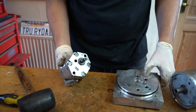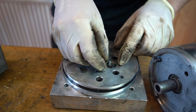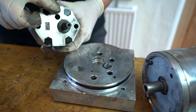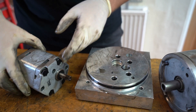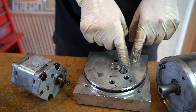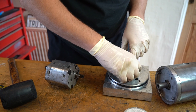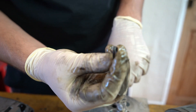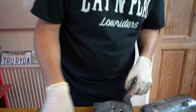Pop this pump head off and as you can see, the o-ring is tattered. That o-ring is supposed to sit in there and create a seal between your pump head where it draws the fluid in and your block. When this tries to pressurize, it'll be blowing fluid past that seal and back into the block, so you won't be getting the same level of performance. It's always worth checking the condition of that o-ring, especially after a good few shows. If you've been over-locking on the switches and over-pressurizing, something will give up - and ideally you want it to be something as simple as a little o-ring, because you can pick them up for next to nothing and replace them relatively easily.